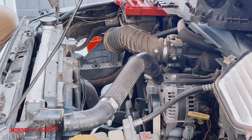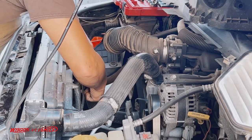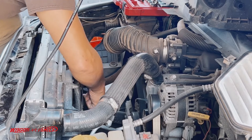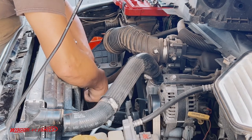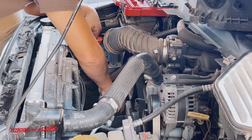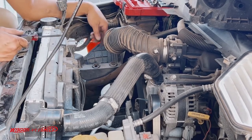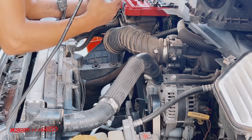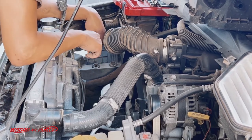Now I'll remove the lower radiator hose with a flat screwdriver. When I put the radiator hose on I put the clamp screw in a bad spot, so next time I'll put it on the side so I can access it easier — not very good thinking on my part. Once we put this back in all we've got to do is replace the fluid we lost out of the radiator, not the engine. We'll need to burp it but it won't be as bad as a complete flush. If you guys haven't seen that flush video, I'll put a card up here.